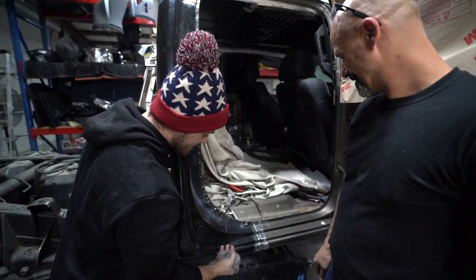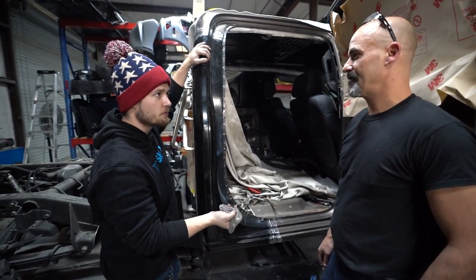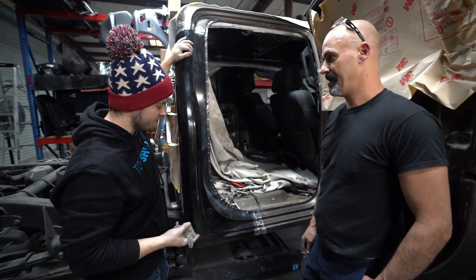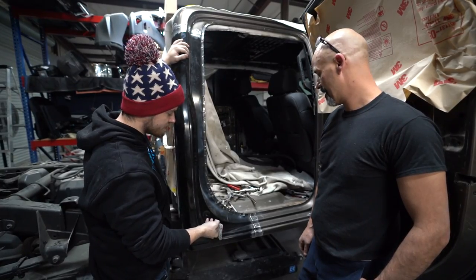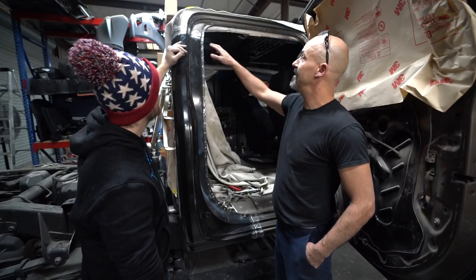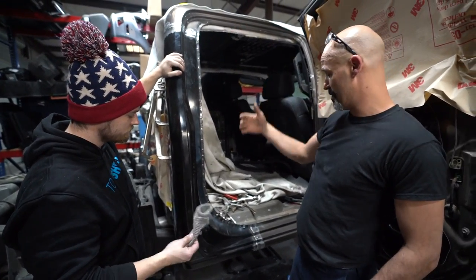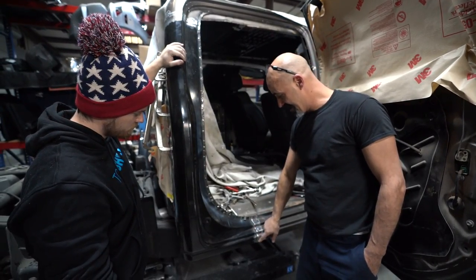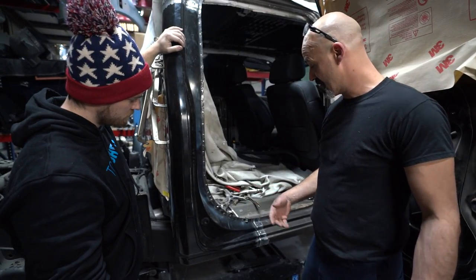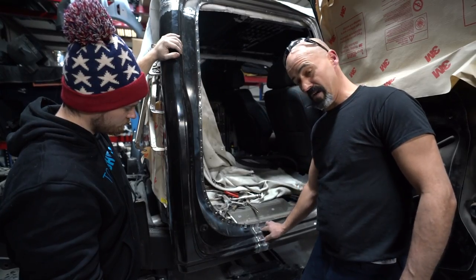What he's basically done is completely sever this piece, clean it out, and weld it back in place. Now, there are a few more steps you have to do that will take place off camera, just for convenience's sake for Mike and everybody else. Now the process is to grind these smooth and then... Yep, absolutely. So we're going to take it from here, and these are cleaned raw welds, so they're not super pretty looking at this point. As you can see, they're stacked, stitched together the way they're supposed to be, plug welded just the way they're supposed to be. From here, we'll take the grinder and finish all the welds off nice and neat, almost metal finishing the panel.